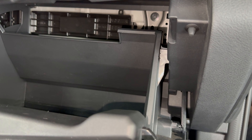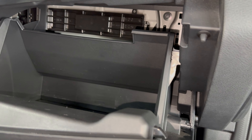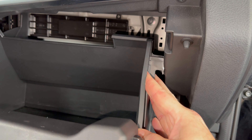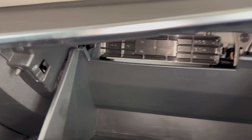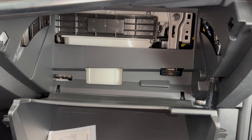Now there's two stops that are holding the glove box up, preventing it from coming down. We see one right here that my finger's on, and there's another one just like it on the other side. So what I'm going to do is push in towards the center of the glove box, and you can see it allows that stop to clear. I'll come over here and do the same thing — this takes a good amount of pressure. It's probably easier to use both hands at the same time. But once we get those two stops to clear, the glove box will come down like that.